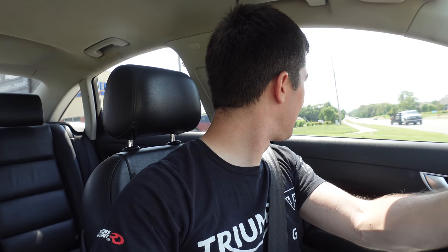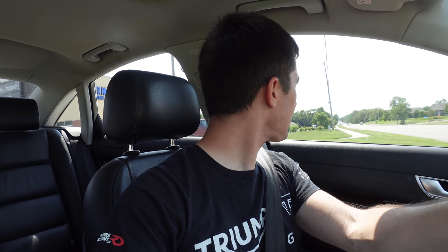Alrighty. No creak when you turn. So I think we solved one major problem. Relearned the TPMS last night. The only lights left are gearbox malfunction and fog and brake pad. So I need to check the brake linings, obviously. Fog light, still need to code out. I gotta find somebody with VAGCOM, I think, because I'm just not having any luck.